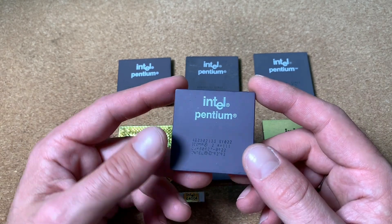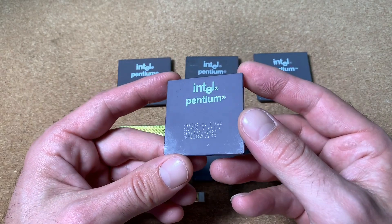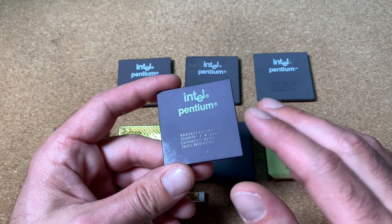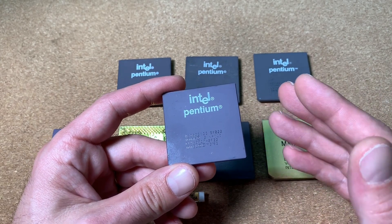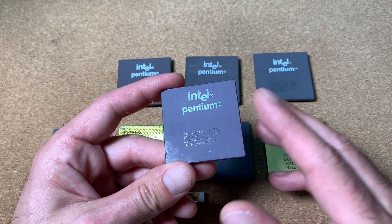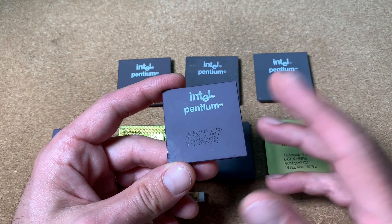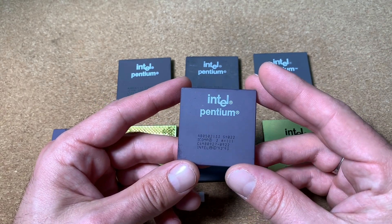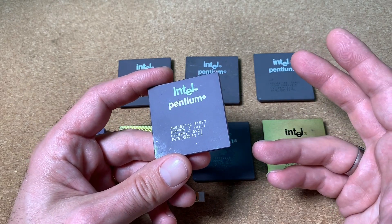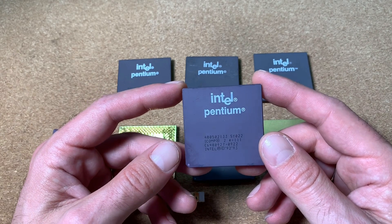For example, reprinting a 120 MHz CPU to 133 MHz or 150 MHz. Back in this time you just set on your mainboard the speed of the CPU you bought, and that was all. So at the end you were overclocking your CPU, and the outcome was that the system might become unstable or crash randomly. Some were more stable, some were less stable, and you could not see the original clock speed it was made for in any software tools.